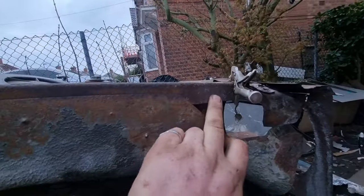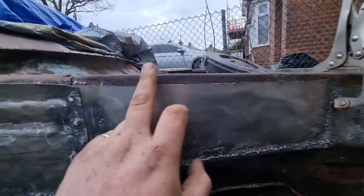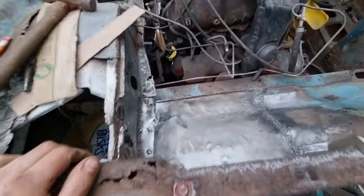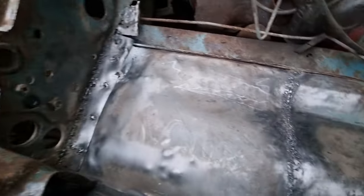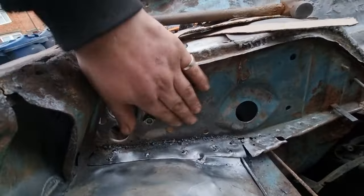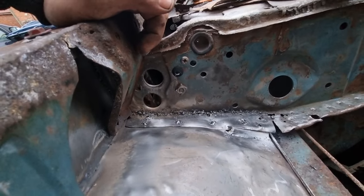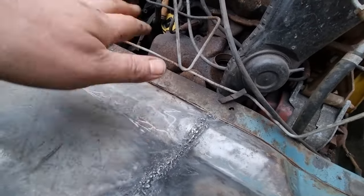So all I've got to do is weld that to there, cut that a bit across there, weld it all the way across there, fix this top — and that's done. I've got to knock these dents out a little bit. I've got the new lip there — that's why I grind the welds down. All this has been cleaned, I've got to clean it a bit more, ready for primer. So when I finish filming this, I will spray some white primer on it, just until tomorrow when I get back out here.